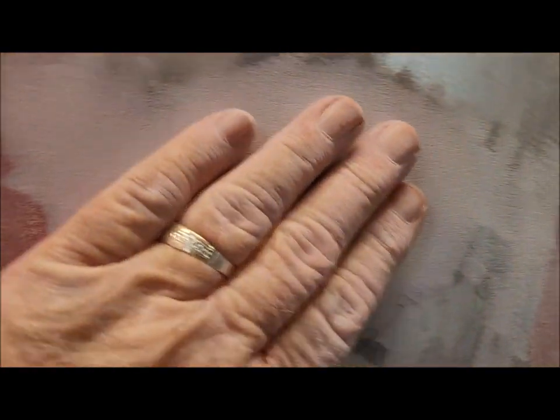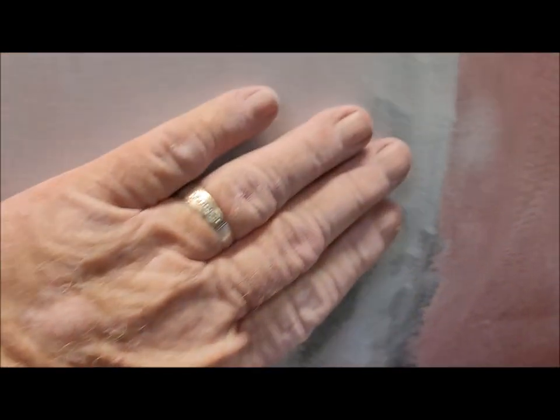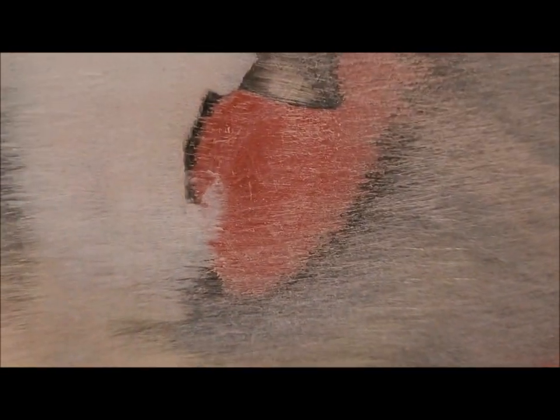Okay. As you can see, it's really not that thick. This area in here is the thickest, which is where I had to shrink it down some. And then there's one area here that's showing low because it's not been scratched too much, and the bondo is still high there. So I'm probably gonna have to do a little fill there.